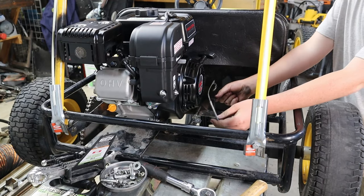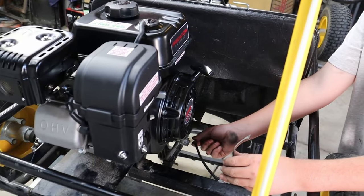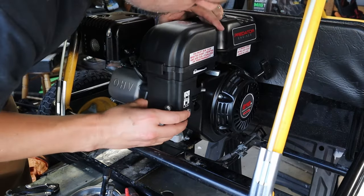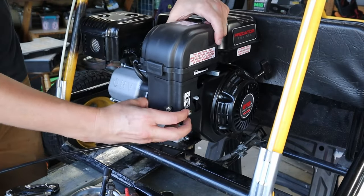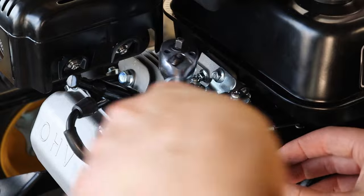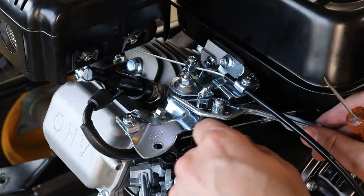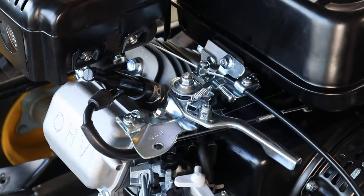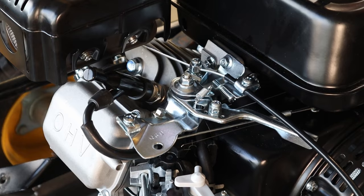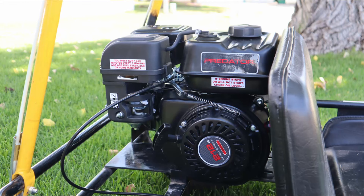The existing throttle cable was a little short, so we grabbed a new one — just a throttle cable off of a motorcycle. A bike brake cable works as well. Up on top, the first step is to take off the 10 millimeter bolts for the air filter housing, then put that aside to get access to the linkage on top. Loosen the bar just a little bit, tighten down the sheathing, run the cable through the little bolt-nut — whatever you want to call that — tighten that down, and as an extra precautionary step, I always add another spring just to close the throttle when your foot's not on the gas.